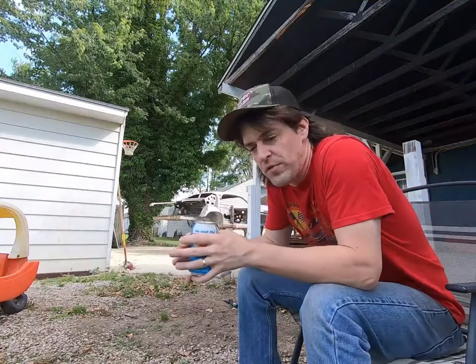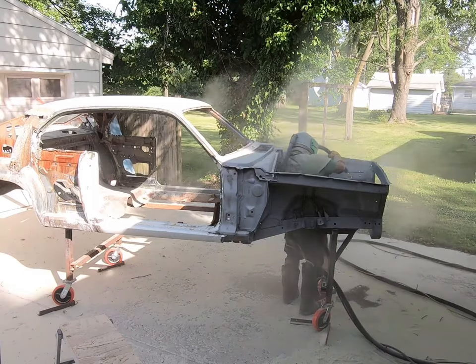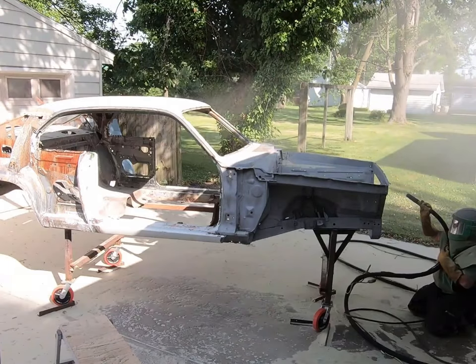One thing that he's clearing up for me, if you've noticed, we were calling it dustless blasting. That's kind of the overall product, I guess you can say, of how it's marketed. But you see there's no water and there is some dust. He explained to me that's because the media, that glass, has sharper edges on each granule, more so than sand, which is kind of round when you look at it really close. The warpage that comes from the sand is from that working so hard and just repeatedly hitting and hitting, and that's what gets the heat generation, and then you'll warp it or tear out too much. This does it quicker because it's sharper. It basically dings the rust and dings the paint and blows it off, and he can just move a little quicker. That's why it looks like it's literally going quicker.